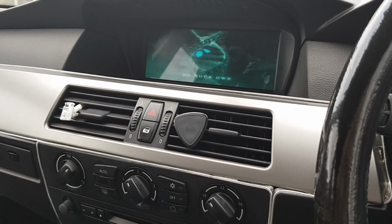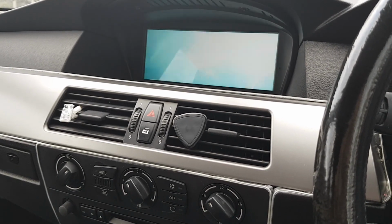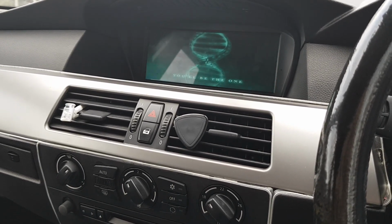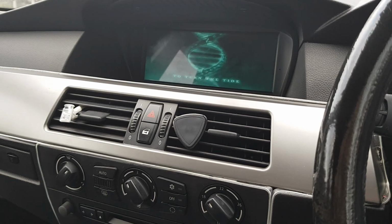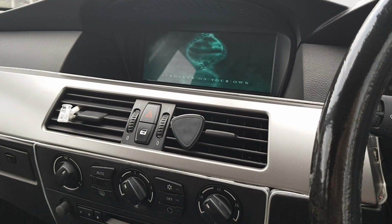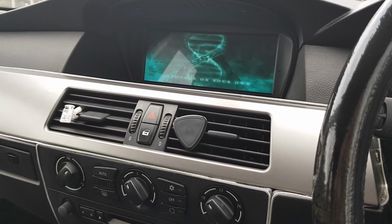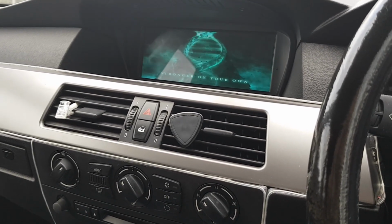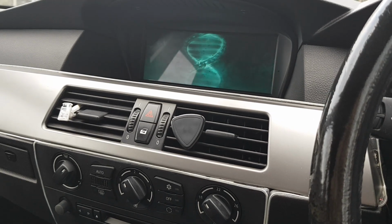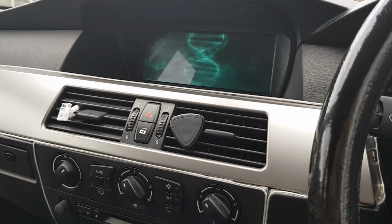Many sellers, as far as I can see, advertise cameras saying that they've got a viewing angle of 170 degrees, and it's supposed to be a plus. So I bought two cameras, one which is a normal camera without any extended viewing angle, and the second one with the extended viewing angle. One camera was installed for the backing plate numbers, so this is the camera which includes the LEDs, and the second camera is for the opening of the boot, so you've got this as a handle. So the handle one is the 170 degree one.